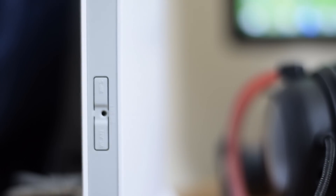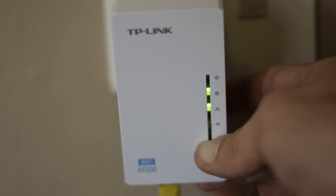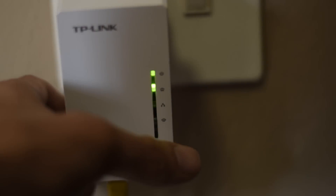The solution for setting up Wi-Fi range extending is very simple. First, go to your router or modem and find the WPS button. Hold it in for about two to five seconds and let go. On my router, a light illuminates letting you know WPS is active. Then head to your wireless powerline adapter and hold down the Wi-Fi button for about two to five seconds as well. The light may turn off and then come back on after a little while, indicating that the Wi-Fi signal was cloned and you now have wireless range extending from that unit. Very simple, quick, and easy — both for setting up the ethernet and the Wi-Fi.